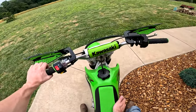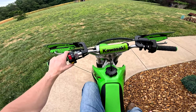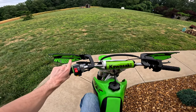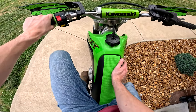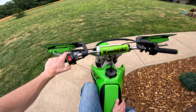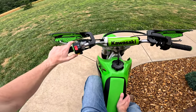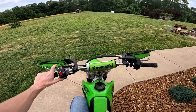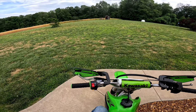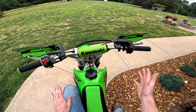Right here I have a choke — every bike is going to be different. Some chokes are on the side, some bikes have a key. These do not have a key; my key is my kill switch — flip it on and the light turns on. To start the bike, make sure you're in neutral. Easiest way: grab your clutch, press down all the way to make sure you're in first, then up a half click. If you did it right, your bike should start with no clutch needed. If you're in gear and it won't start, either pull your clutch in or just get it in neutral — practice getting it in neutral. Kill switch on, start bike — we're running.